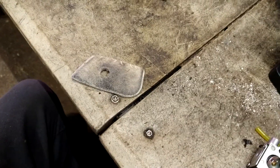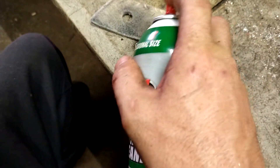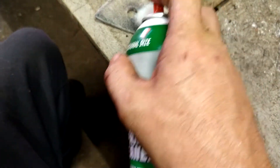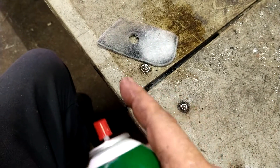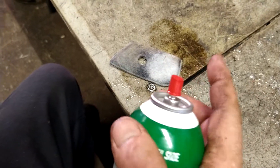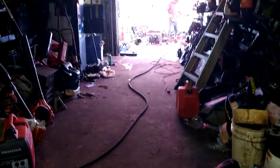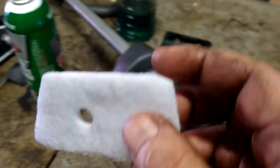We'll have a brand new filter in it. Just in case you want to clean yours, it is cleanable — just use carb cleaner or brake cleaner and it'll clean right up. Blow it out with air when you're done, or if you don't have an air hose, just stick it out in the sun for 10-15 minutes and it'll dry right up. The kit comes with a brand new one, so I'm just putting that in for the customer.